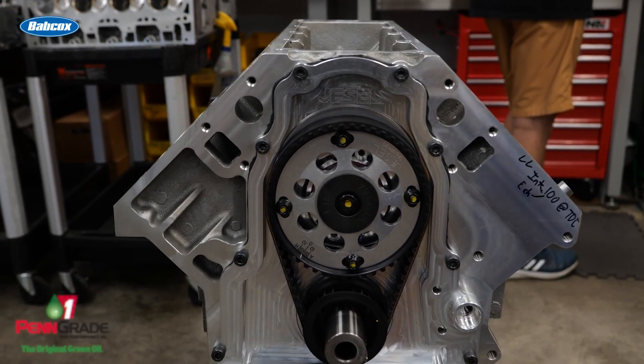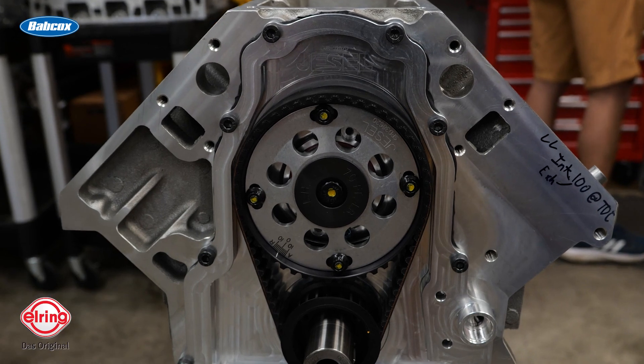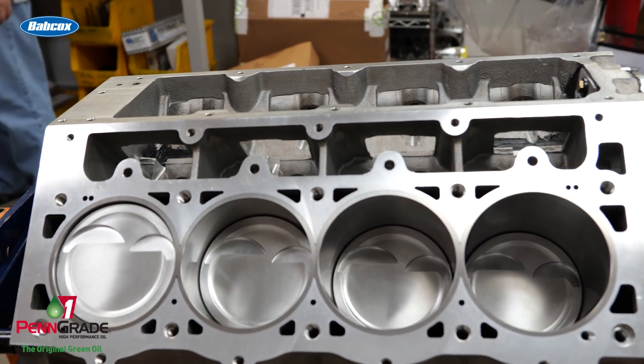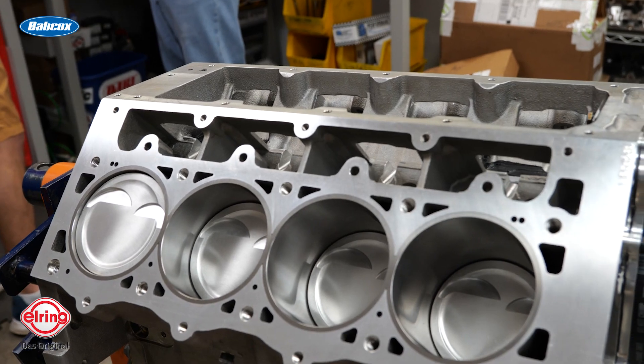It's a 465-inch race gas-specific, basically an LS7. It's a Dart aluminum block. It's got big lifters, a big camshaft, a billet belt drive. It's been modified so there's no oil drain back to the bottom from the heads — it's all scavenged via a dry sump pump, which isn't on it right now. This is kind of our king of the hill road race engine. It should be about 900 to 1,000 horsepower depending on cam. With a more moderate cam for a lot of mid-range, this motor should have about 950 horsepower — about 850 at the wheels — and it should be really reliable. It's got a really fancy oiling system.